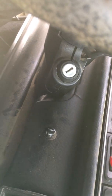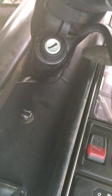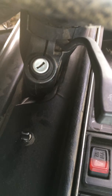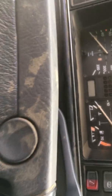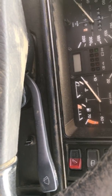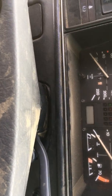And then the ignition switch — that's a new one in there already. I needed to drill a hole in the housing, which was probably right about here. And then there's a spring that I need to push down with a wire or a sharp tool, and then you just pull the lock out and shove the other one back in. But there's also the signal light housing, or signal light switch, and the wiper switch attachment on there as well — it needed to be taken off.